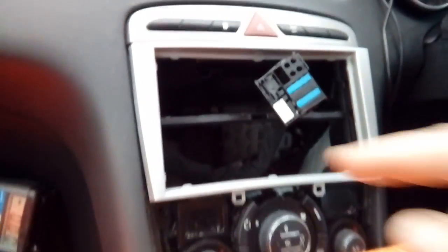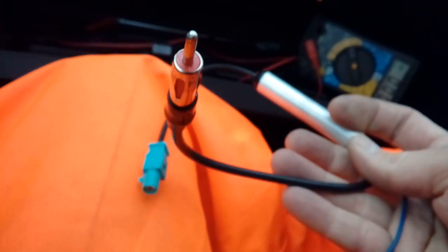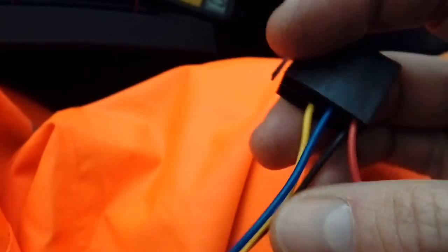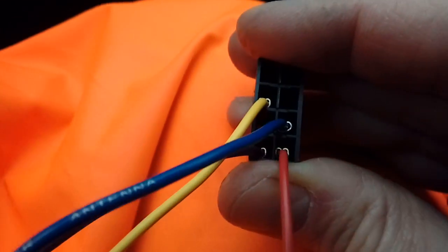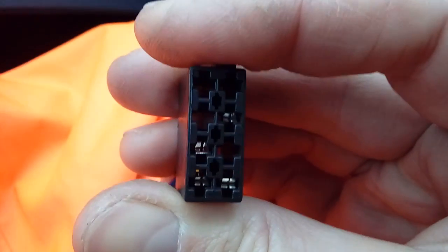Next thing to do is run the power cable to the fuse box — it's a very nice and easy job on one of these. You just pop the red wire that comes with the kit down here at the bottom and then up into the fuse box. Here's the wiring harness adapter — it has a red power cable that you feed through and end up coming out where the fuse box is. Here's your aerial adapter to convert from a Fakra connection like the car has to a normal aerial. You'll notice it has a powered filter cable — this blue wire — you just shove it in, make sure it goes the right way around based on which way it's crimped, and it just clicks into place.